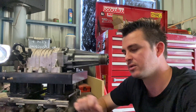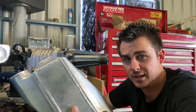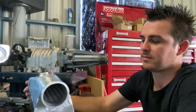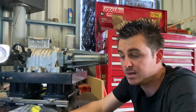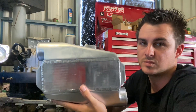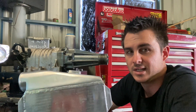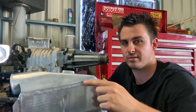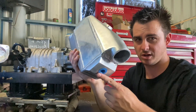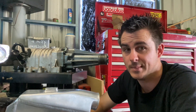The next idea was this — a generic water-to-air intercooler off eBay, 100mm x 100mm, so quite a substantial jump up from that little 19mm core. They're a pretty basic setup with end tanks welded on for intake piping. We're not going that route though — the plan is to cut the tanks off on both sides so we're just left with the core in the center, with water going in one side and out the other.